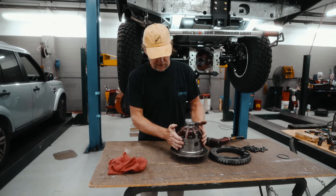So we've got a new genuine flange, a new nut. And then like before, I'm gonna tighten this down just to take up the free play. All right, so we have the free play taken up on this now. The idea now is to crush that sleeve. So that sleeve will start crushing at 250 foot-pounds. Obviously that's a lot of force.